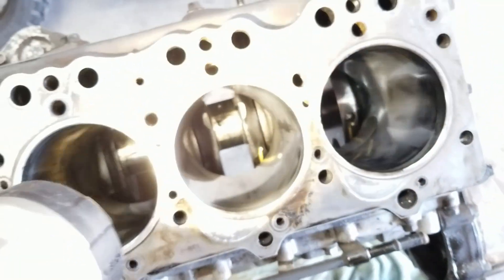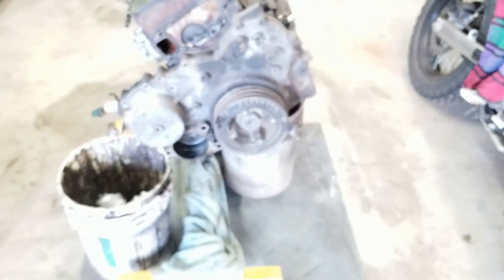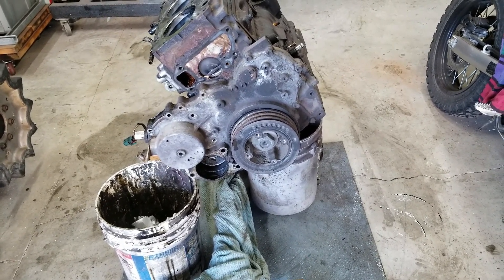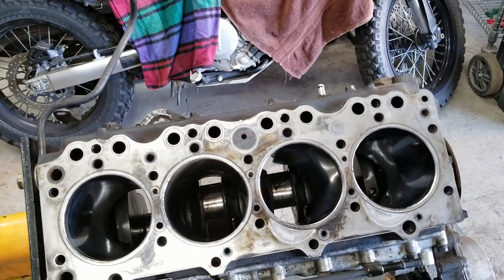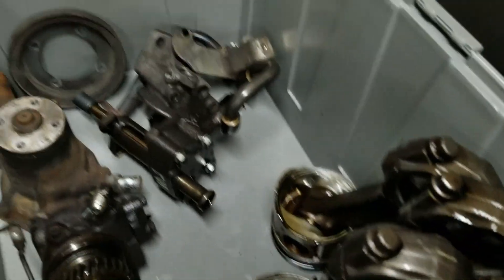Definitely still going to have to get liner and piston kits. As luck has it, I still need to get whatever size that bolt is — 40, I think it's 42, I calipered it — so I'll have to order one of those. I'm kind of at a standstill here because I can't get that front case off without doing all this other stuff. For now I've got it torn down as far as I can, and I'll deck the top of this block after I pull the liners, then put the new liners in, clean it up, and run a bunch of this stuff through the dishwasher.